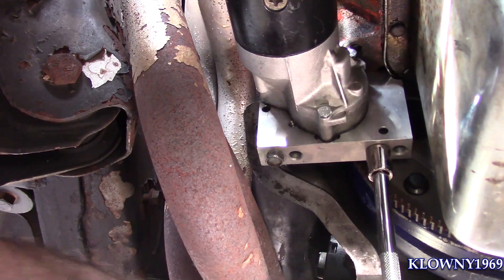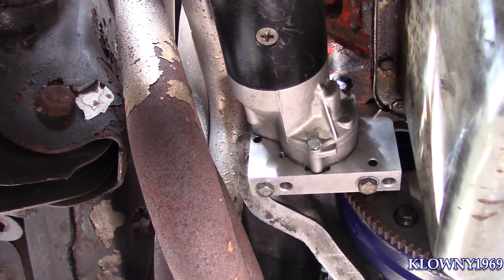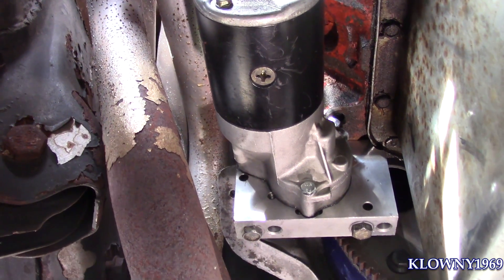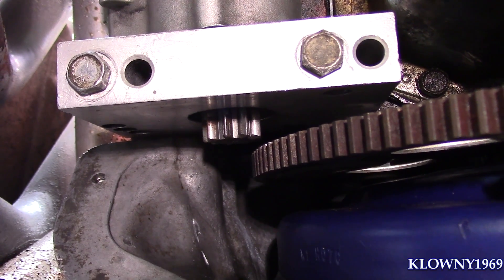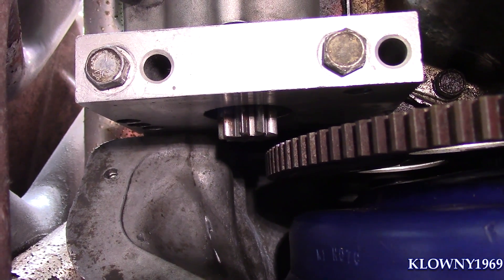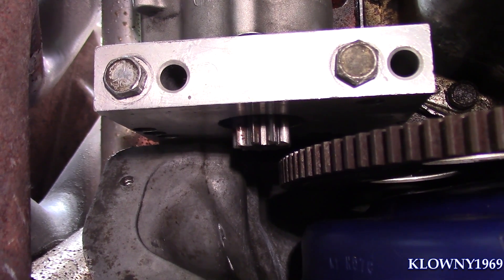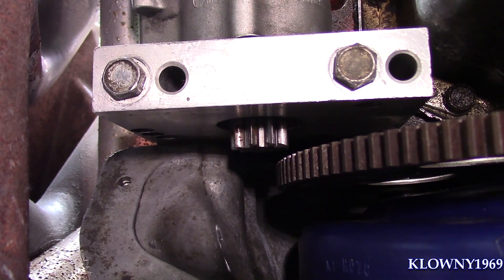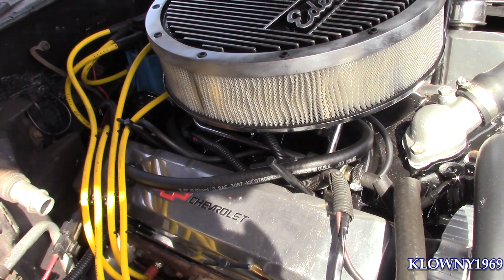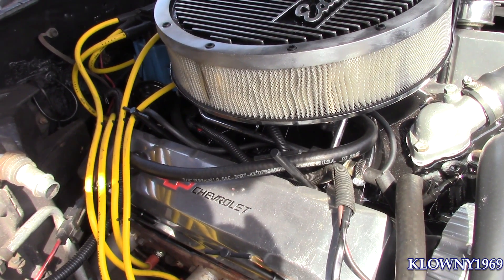She's good. Now that I've built the starter back up, you can see it lines right up — it's not crooked at all. I connected the wires on top to the solenoid, and now we're going to test start it. I disconnected the ignition coil so we can crank it without firing. We'll crank the car and see if we hear any bad noises or if it hits the flex plate. And that's perfect engagement! That's how you drill a block to fit a 153 tooth flex plate with an inline-bolt starter on a pre-'60s block. Thanks for watching — subscribe, like, and share.